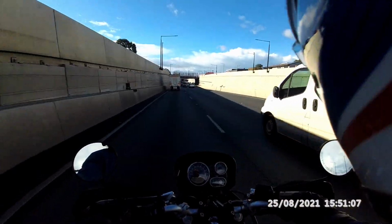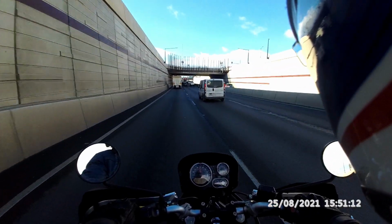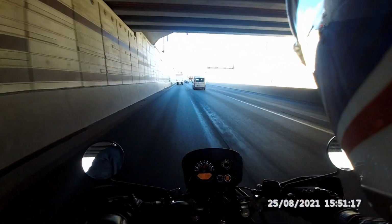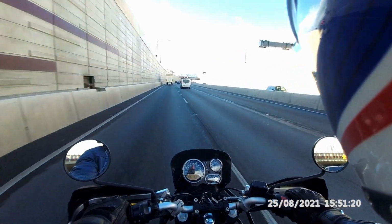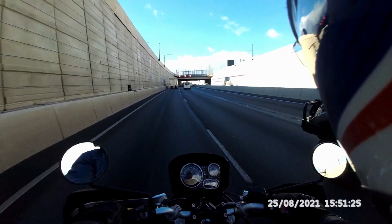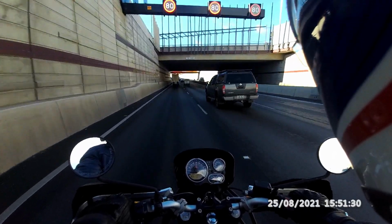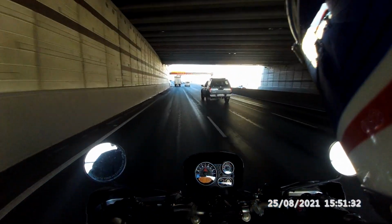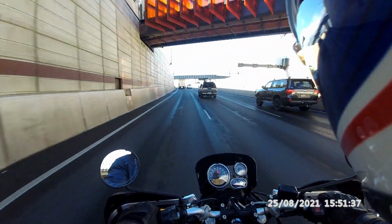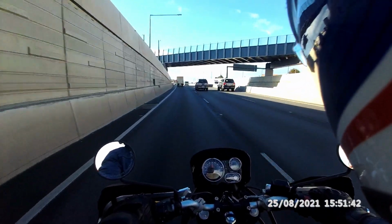Right, now that I've had a chance to ride it for a bit, I guess I should give some sort of rundown on how the suspension feels with its upgrade. I'm a big bloke, and prior to the changes I used to ride it with the preload set at around notch 6, which is a fair way up. I've put in 9mm spacer and been able to bring the preload all the way back to notch 1. At that, I haven't done a sag test, I should tell you. This is all seat of the pants stuff.